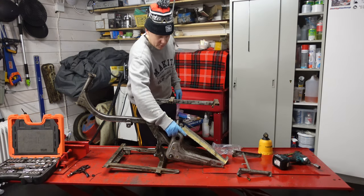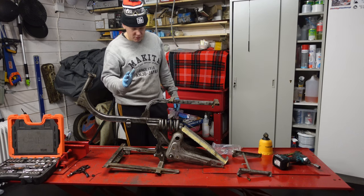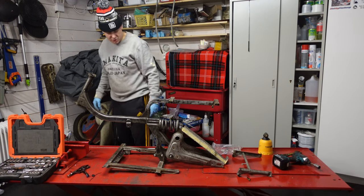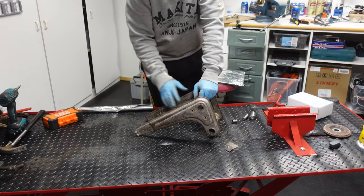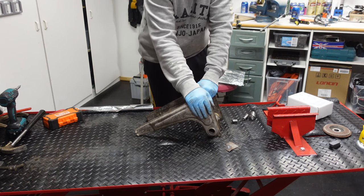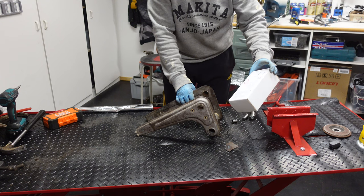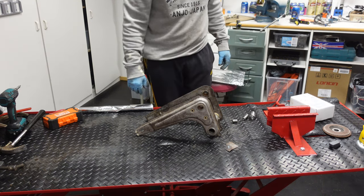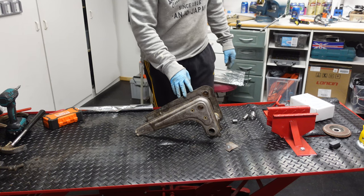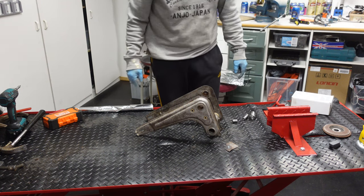Now I'm wondering whether I should powder coat this swing arm to be chrome, because I have that kind of paint. Unfortunately, the powder coating system is not large enough to handle the main frame. But let's continue. About painting the swing arm, I've been battling with two different solutions. One with the normal epoxy and then the gray. Or now that I have the powder coating system and I also have a metallic gray color, I could do the powder coating, which would be a more durable version of the paint. And I'm also going to use the same color for the wheels. But should I first try if the wheels fit inside the powder coating oven?